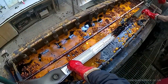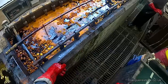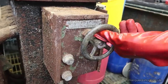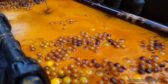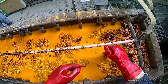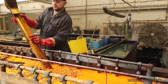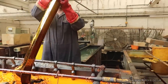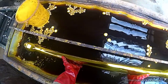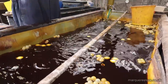Now here we go into the chrome tank. The chrome layer is really, really thin — it's just a flash of plating over the top of the nickel. Although it changes the colour, its main job is to stop the nickel from tarnishing, because although it's nice and weather resistant, nickel does tarnish like copper or brass. Without the chrome layer on top you would have to polish your car bumpers every week or so to keep them shiny. Once the chrome is on top, because chrome doesn't oxidize — it's a noble metal like gold — you don't have to polish it, you just have to keep it clean.